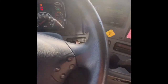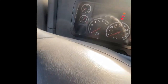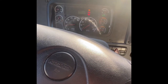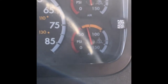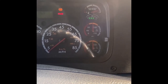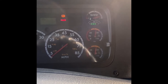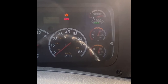Now you're gonna do a safe start by ensuring your transmission is in neutral. Engage your clutch and start your truck. I'll go ahead and unchock my wheels while my pressure is building on my gauges and waiting for my air tanks to come up to normal operating pressure. While waiting, if you noticed in some older videos, the torsion bar was missed — this is the perfect time to let your examiner know. The torsion bar is proper: it's secure, not cracked, bent, or broken.